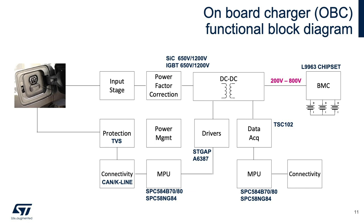After the line voltage enters the vehicle, it is usually filtered and then it connects to a power factor correction block. PFC not only ensures that the OBC operates at peak efficiency from an energy usage perspective, but it is also used to reduce emissions by mitigating the nature of the load presented to the grid by the vehicle.